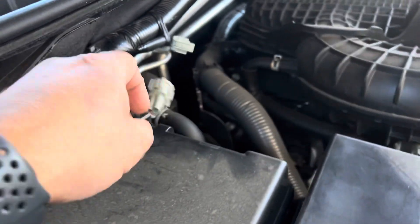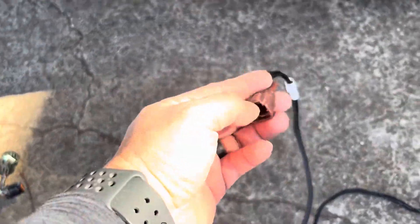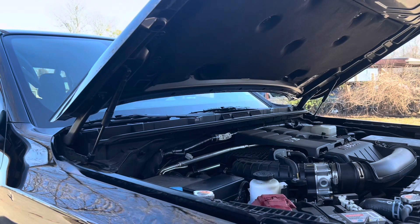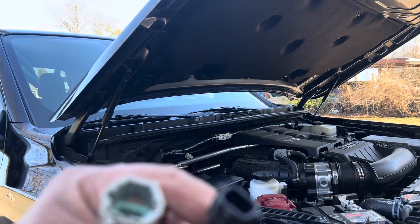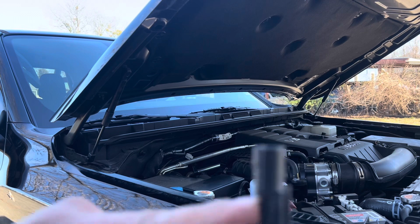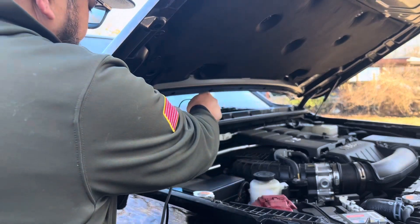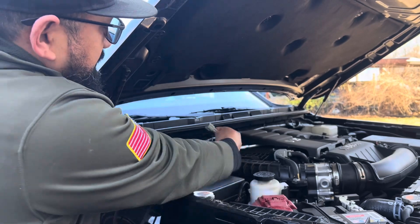So it's basically a run-through of how this wire harness is going to go. You're going to plug it in here, throw it down through the chassis, follow it all the way to the back, and connect it. Then this runs back to the bar itself, and these are the ones that are going to be hooked up to the brake light. When you start running your wire, start from the front with the small end and push it down through the chassis — you'll have to run it through some very tight spots. Make sure to keep it away from all the other wiring.